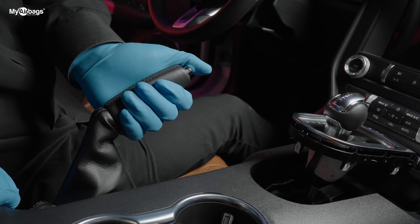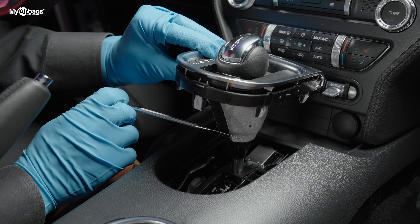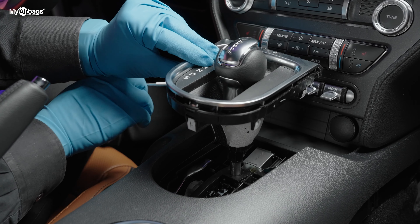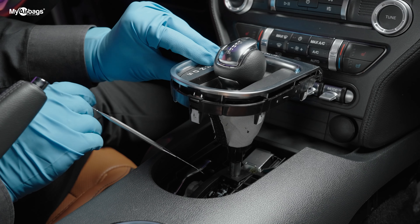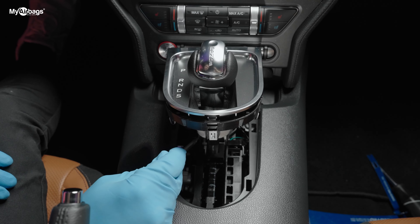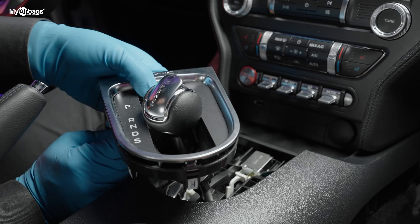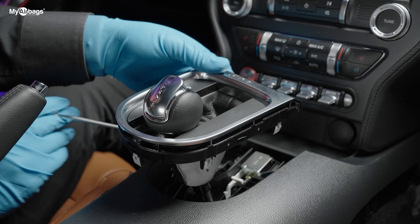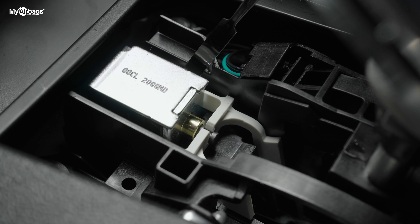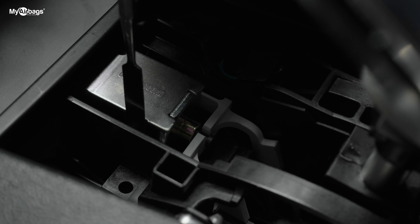Go ahead and engage the handbrake and make sure the vehicle is on level ground. Next, get this part off — there are screws on the front and to reach them we need a little clearance, so we're going to move the stick back. There's a little white plastic piece here that we need to push upwards, then grab the stick and move it backwards. Make sure the brake is on, you're on level ground, and you have something behind the tires. This is the little white piece that locks the transmission stick in place — you can remove it from either side and then move the stick down.